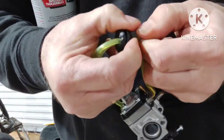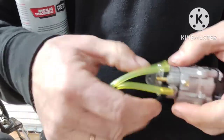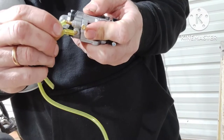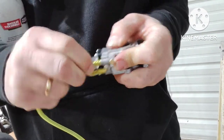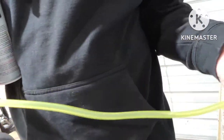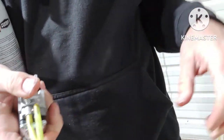Alright, so then I'm just going to pull it to the length that I need — right there — and we're good to go. Give it a clean cut. Now get the fuel line, get that to the right length. This is the other one. I'm going to put the fuel filter on it and then we're going to mount it back up.